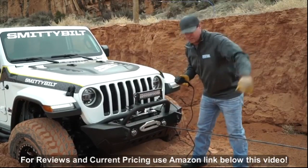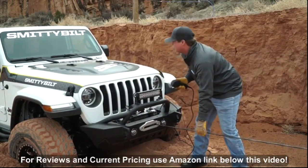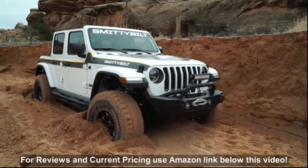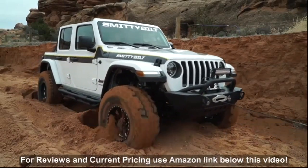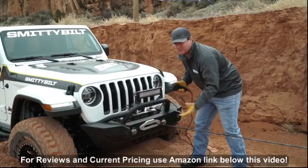You're going to want your stable support vehicle to have somebody holding the brakes, otherwise you'll tear the parking pin out of it. And then on this side you're going to want the driver to be giving it just a little bit of gas — not enough to run me over, but enough to assist the winch pull. That's going to get you out of these big holes where everything's glued down to the ground.